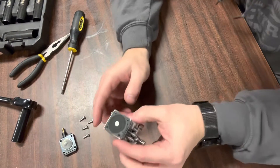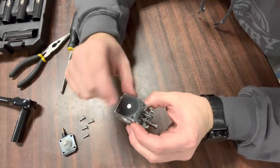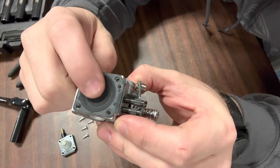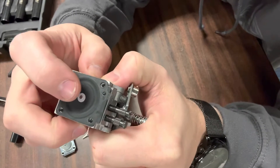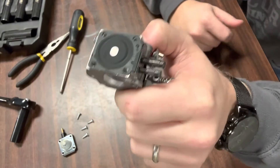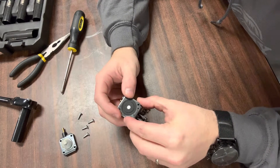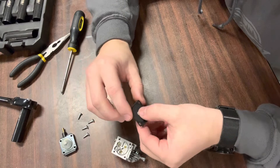This is the gasket you have to be most careful with. If this is a carburetor that's been on a unit for a while, this is going to tend to stick around the sides. If you rip this gasket — because it works off of air pressure — this diaphragm, as you can see my finger bounces back and forth. If you rip this, the air pressure is not going to work right and you might as well buy a new carburetor. If you press on this and it doesn't rebound, it's so brittle from the fuel over the years that you're going to have to buy a new one — at least a new gasket and diaphragm. It doesn't matter how well you clean it; if this is not rebounding correctly, your piece isn't going to work.